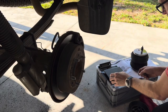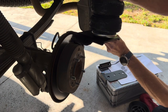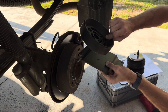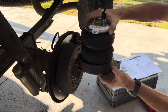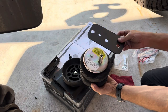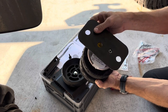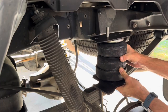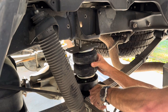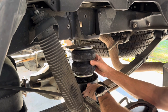The next step calls for mounting this onto the bracket that goes over the leaf spring. However, we're skipping the step where we're screwing into the Firestone, because we are installing the Daystar bracket — that's where this is going to just set on top of and be free floating. Align the hole with the pin. Obviously it doesn't go but one way. It's the bottom bracket; we don't have to worry about the alignment, the instructions state. This is going to be bolted straight up in. There are two pins here in the frame — those go into these two holes. Super simple.